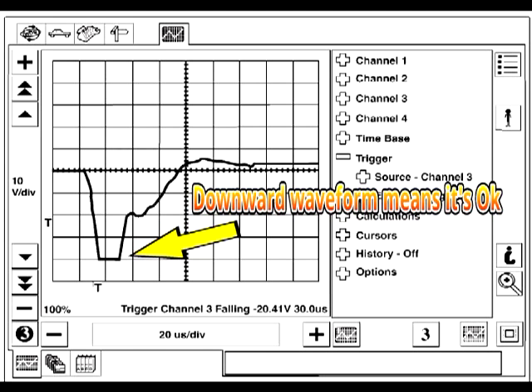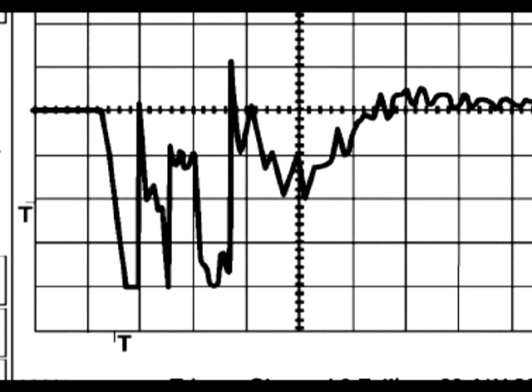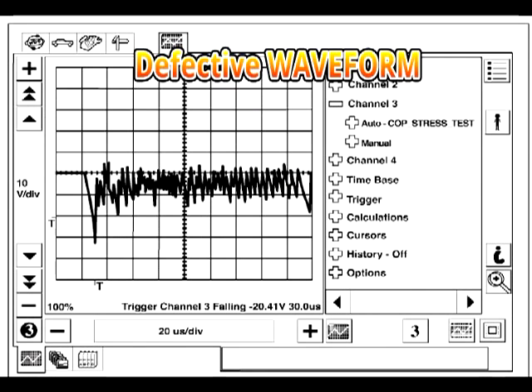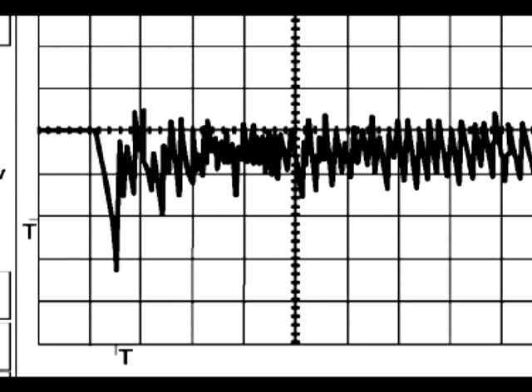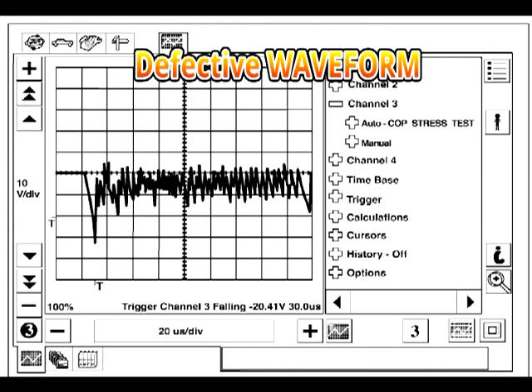Notice the downward-going hump on the waveform pointing to a properly firing coil upon free air. The next few waveforms point to a faulty ignition coil not being able to provide the proper kilovolt firing values needed for the spark to jump the gap. These faulty waves belong to the culprit coil in question. Also, these waveforms are not the usual waveforms seen when reading ignition signals — they pertain only to this COP test procedure.